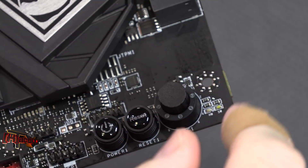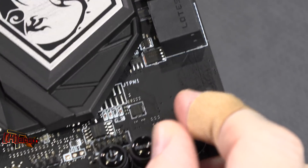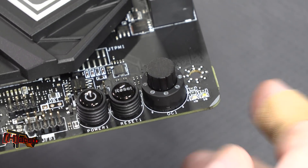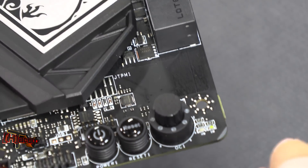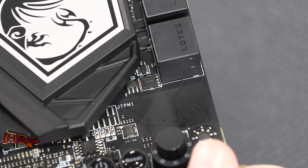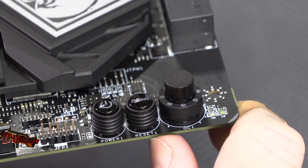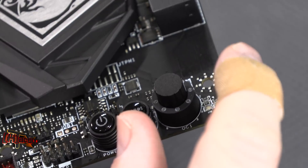There's a little knob here — MSI's Game Boost feature for automatic overclocking. You can also do this in the BIOS without touching the physical knob, and it's gotten a better look recently. MSI is telling us that with Game Boost, they're seeing 5.4 GHz all-core and 5.7 GHz single-threaded on the 9900K (versus stock 4.7/5.0), 5.3 and 5.6 on the 9700K, and 5.0 and 5.3 on the 9600K.